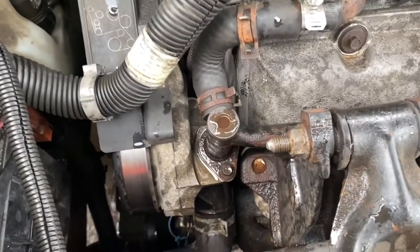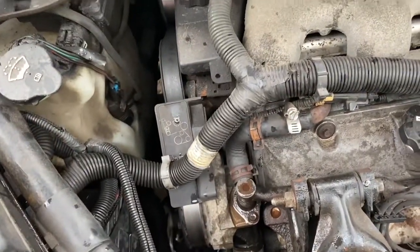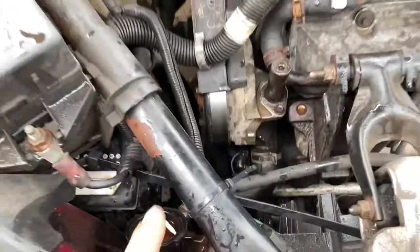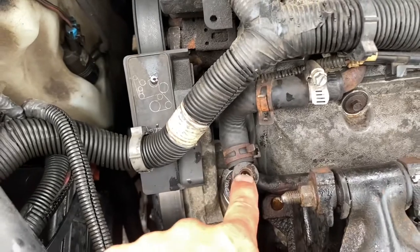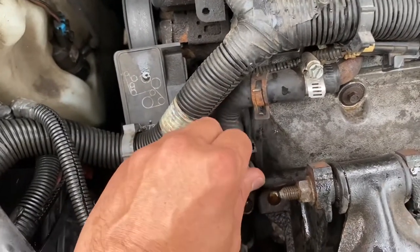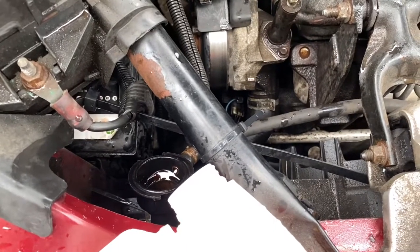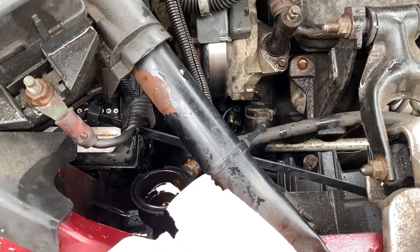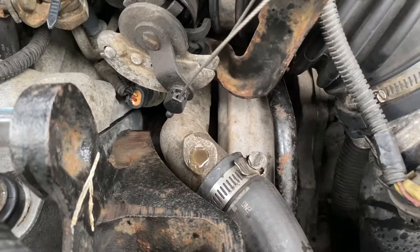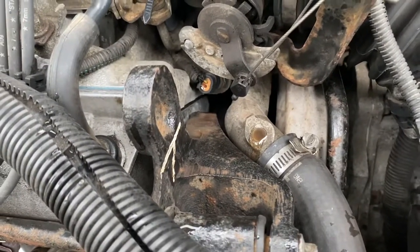I'm at the point now where it's starting to come out of the first bleeder as I'm pouring in. So I'm going to stop pouring for a second and put the plug on that one — not even finger tight, just in a little bit. If an air bubble won't come out, you can pour into the bleeder hole directly until it overflows. Keep pouring until it starts coming out the other hole — it just takes a while to circulate. And now it's starting to come out the second hole too, so we're going to cap that one off.